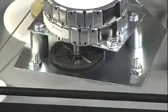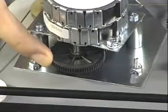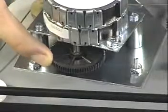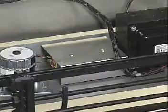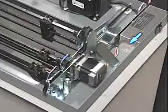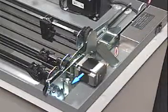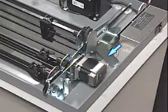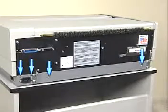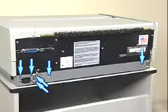When reinstalling the shuttle motor and plate assembly, make sure that there's a small amount of backlash between the motor gear and the first gear. You may also reinstall the shuttle driver board cover. Reinstall the AC cover, the case stop, and loosely install the brace. Make sure that all screws on the back of the base, including the ones on the hinge bracket, are tightened.